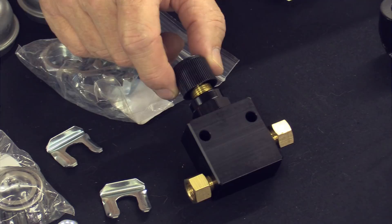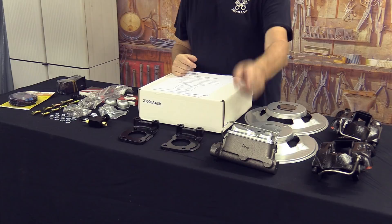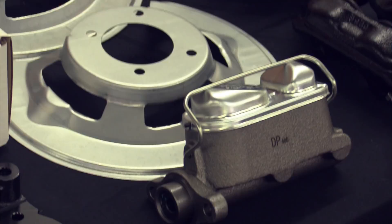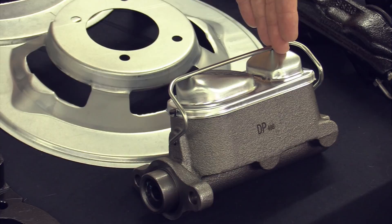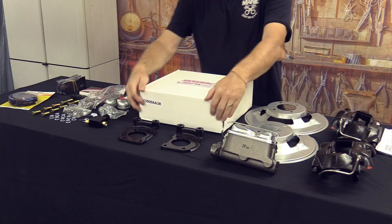One of the first things I really like about this kit is it comes with the proportioning valve — you don't have to go get it separately. It also comes with a dual reservoir master cylinder. If you are putting disc brakes on your car, do the dual reservoir master cylinder. With a fruit-bowl-style single master cylinder, when all the fluid is gone, you ain't got no brakes. The dual reservoir splits the system so you don't lose everything at once.